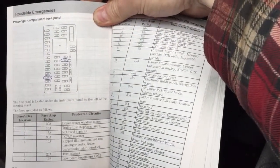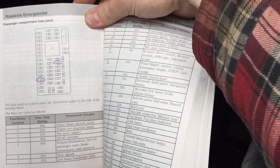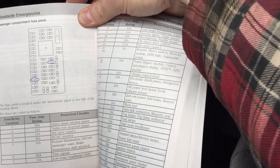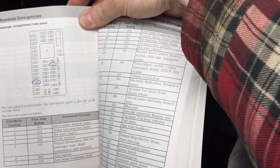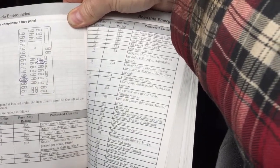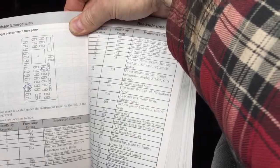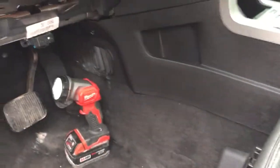What I did is I located in the owner's manual that fuse number 13, which does the keypad and mirror — whatever it is, it's always on — so that's your battery source. Then number 33 is actually a spare and it's an accessory, so it only turns on when the key's on. So there are your two taps right there; you hook your wires up.